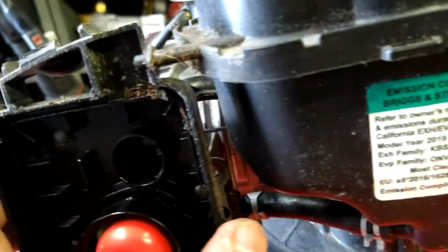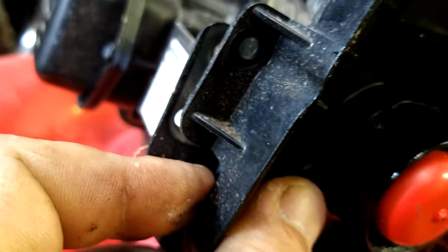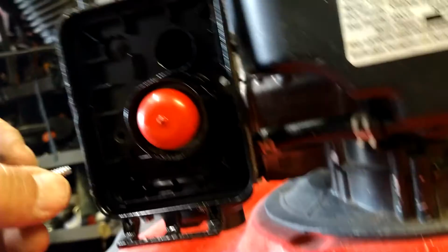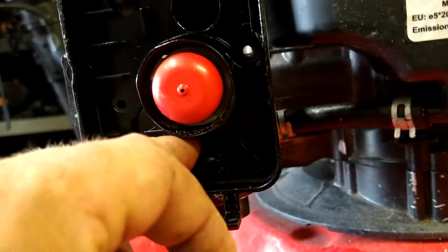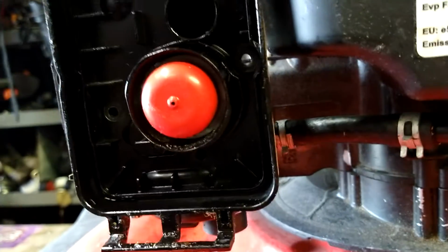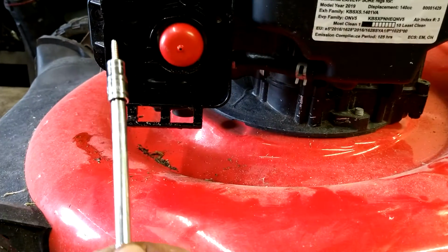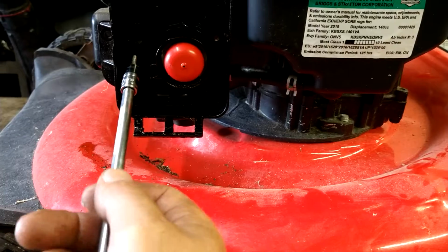The vent goes on this side of it, and then these things have like little studs right there, line up on each side, so this thing will sit right in place like it's supposed to. We're going to go with the 7mm first. They go on each side of the intake, there and there. Pop them in. Here's my 1/4" extension and 7mm socket, it's like a screwdriver.